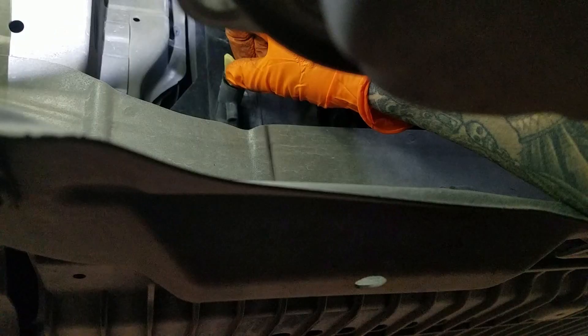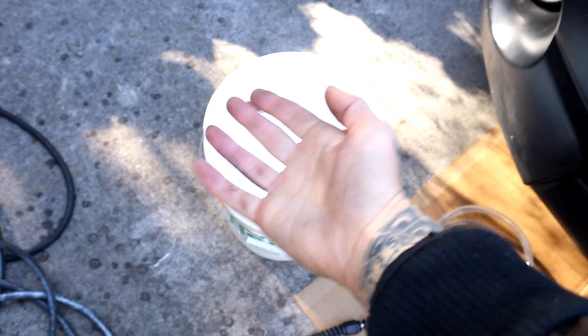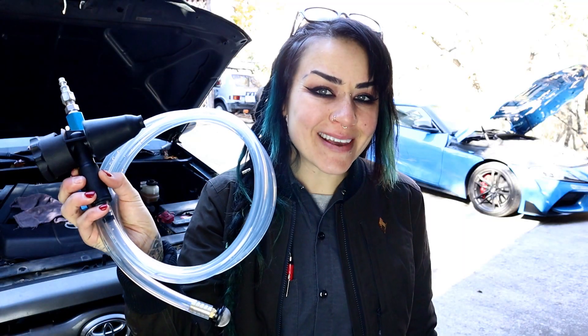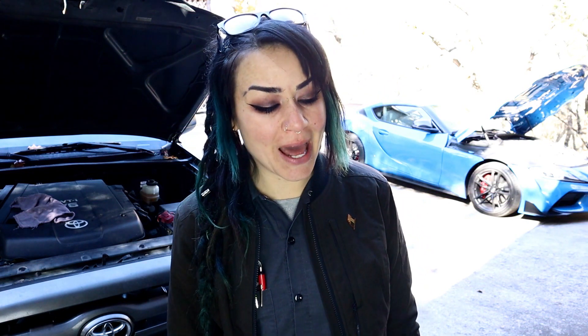You're still going to do your block drains. However, once you have everything drained out and you close up those drains, that is where we will be starting from today. You will need three additional tools to complete this coolant flush using this method, and those are a clean five-gallon bucket, an air compressor, and of course this. I think the five-gallon bucket is actually pretty critical for this job, and I'll explain why in a little bit.